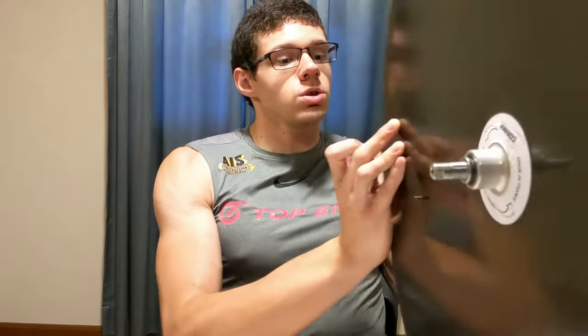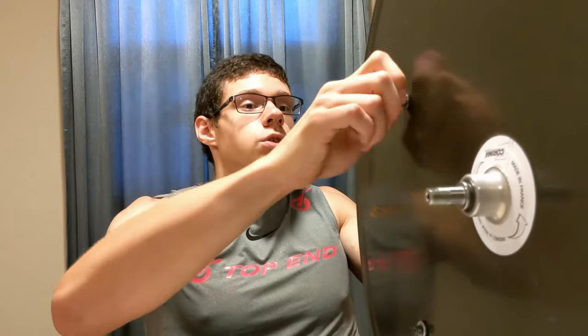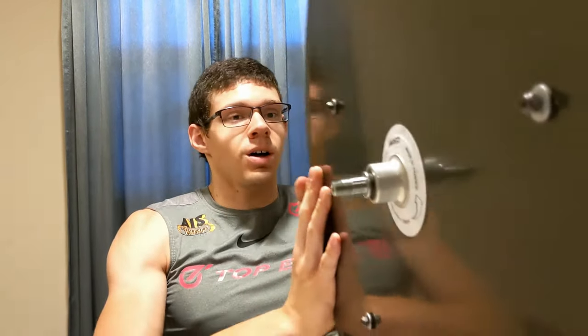Next, I'm going to grab my rubber-backed washers. You want to make sure that you have rubber-backed washers wherever there could be an area of high pressure and low surface area on a carbon fiber piece. So I've put one rubber-backed washer here, and I'm now going to take a nut and screw that on until I just can't do it with my hand anymore, and then just repeat that process.